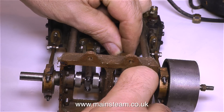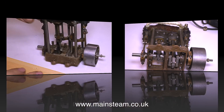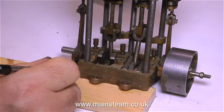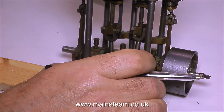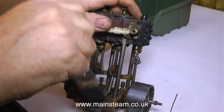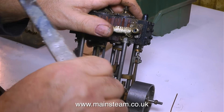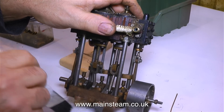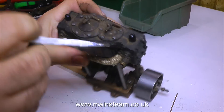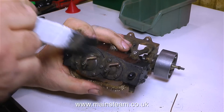But I can't do anything with it in this state. The first thing I have to do is make a simple mounting for it. I'm just using a piece of scrap wood, and I'm going to cut it to length and make two pieces, one for each side of the engine, because it's no good working on the engine with the engine sat on the bench with most of the weight on the flywheel. These crankshafts are not very thick, not very strong, and they do bend quite easily. So once it's mounted on these two pieces of wood, the flywheel will be kept clear of the bench.